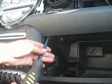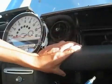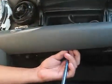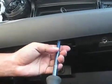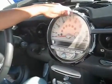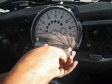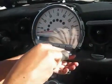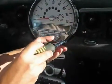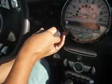To take this plastic part off that's under the secret compartment, you take off these screws. There should be three screws down here and one screw up here — that should be everything you need to pull it off. You won't be able to completely remove it, but you should be able to move it enough to get at the odometer. Just take off these three screws right here. It's not absolutely necessary that you remove these screws right now, but might as well.